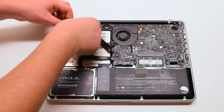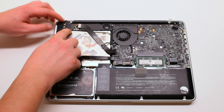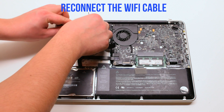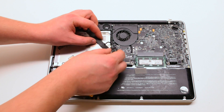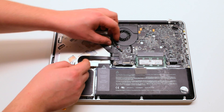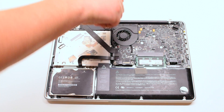Trace out the camera cable and tuck it in along the speaker. Make sure all the antenna cables are tucked in underneath the speaker bracket. Reconnect the Wi-Fi cable — in this example the Wi-Fi cable popped out. Reconnect the other end of the Wi-Fi cable to the logic board. Reconnect the speaker. Reconnect the battery.